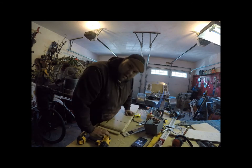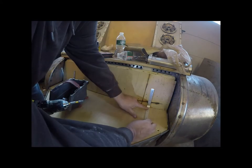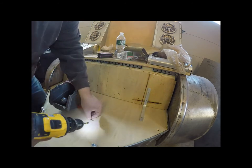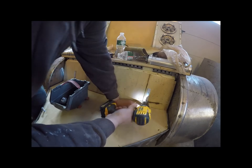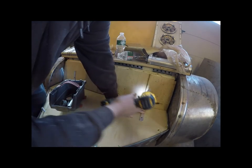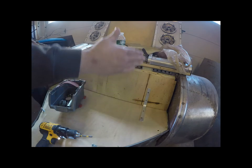We're back on track — just make sure you measure right. I put the piece back in. I have these temporary aluminum braces I had made; I'm just going to tack these in. Then we're going to screw this from underneath on the backside up into there, and that's going to hold it just fine until we laminate it in the sheet metal and weld it in place — then it's not going to move even if it wanted to. Now comes the fun part, the in and out, so we can figure out the gap and have the metal edge to weld to on each side.